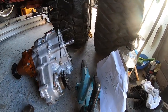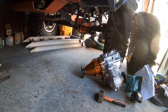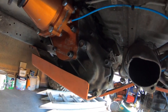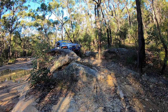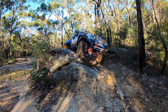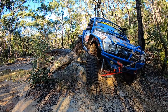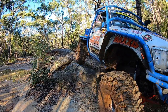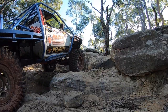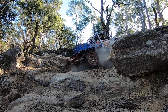Now you're probably rubbing your eyes thinking you're seeing double, but no — the one on the ground here is the one that's just been built, and the one under the vehicle is one that's got the 4.7 Marlin gears in it, an old set of Marlin gears. It's got chromoly Trail Gear output shafts and the Trail Gear rear disconnect. Just got to find time now to swap them over before the next event. Brian and I have been friends for a long, long time — well over 20 years — and he's my go-to man for my diffs and transfers. He's a world of knowledge when it comes to Toyotas. I hope you enjoyed this episode, and as always, thanks for watching.